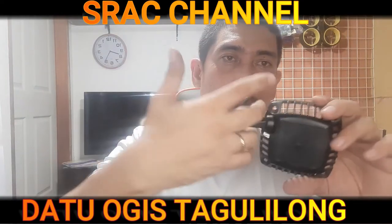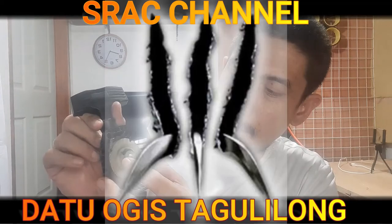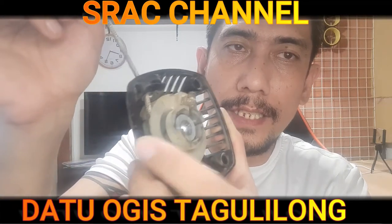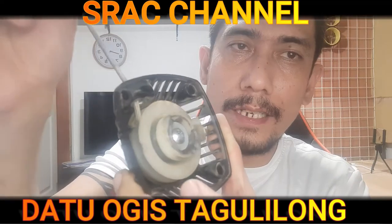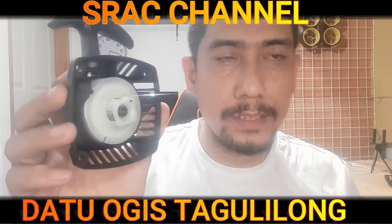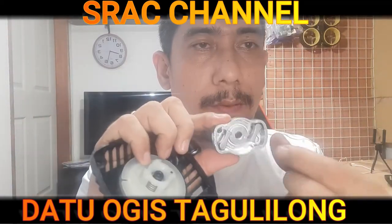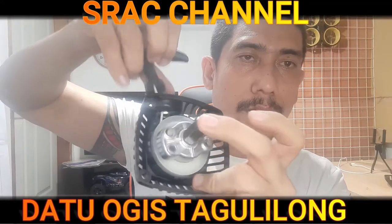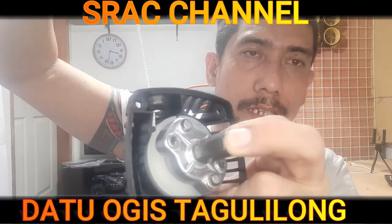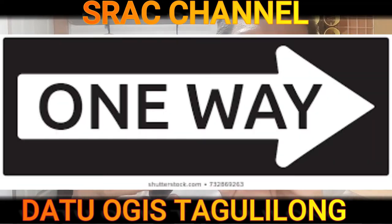The aftermarket pull start handle is very ergonomic and fits naturally to your hands. The stock Genova pull start handle has a flaw: upon pulling the string it engages the teeth in the flywheel, so before you pull you have to feel if the teeth have already engaged the flywheel. The aftermarket pull start does not have many moving parts, hence less likely to break. The dog bone mechanism always engages the teeth of the pull start, but because of the spring it can only engage one way. When you return the pull start, that clicking sound means it allows the teeth to move without engaging the flywheel — that is why it is a one-way mechanism.